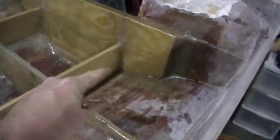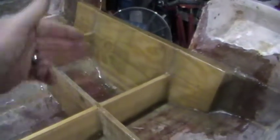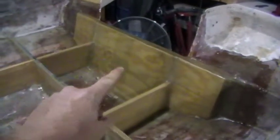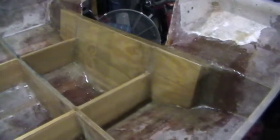As far as the transom goes, I did 6-inch tabbing in a couple of different ways — coming from here, up to here, across there. Then I did a 12-inch here and there and then across, doing it on both sides including the inside as well. Then I did a whole piece of 1708 across. You can see right there is my overlap — that's right about 6 to 7 inches of overlap. So really, that transom is not going anywhere.